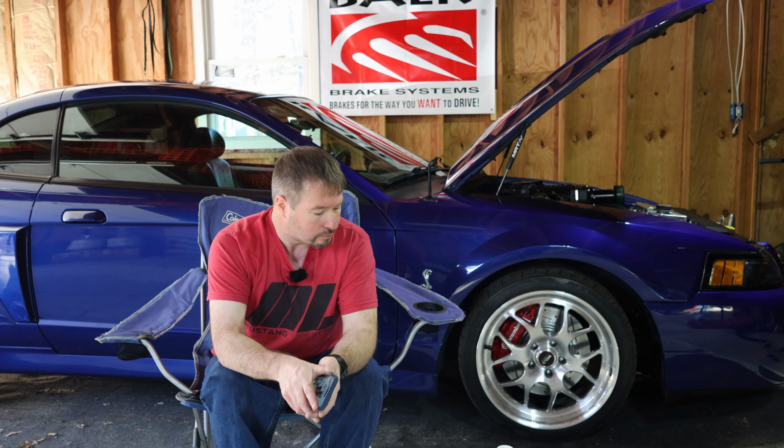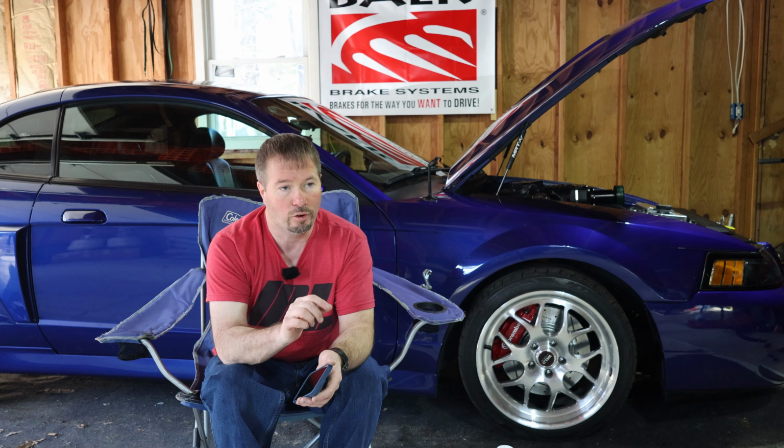The only thing that I didn't like about those coil covers was he gives you new hardware, nice black bolts with a lock washer on it, but they wouldn't thread into where it goes into by the head. They didn't want to thread in as easy as the stock hardware does. And I was a little bit apprehensive about trying to crank that down and stripping the threads where those screw into. So I decided not to use the hardware, even though they're nice black bolts with a lock washer on it. But I think I'll probably reach out to him and mention that the bolt was just maybe not quite the right size, or the thread pitch wasn't quite right, because they didn't want to thread in by hand, and it would thread in with the ratchet, but I didn't want to force it down in there and strip the threads on it. So I decided to just use the stock hardware, and it still looks pretty good overall.